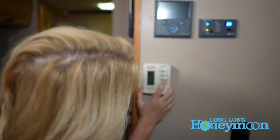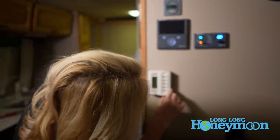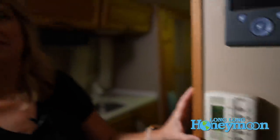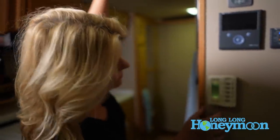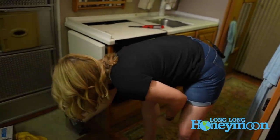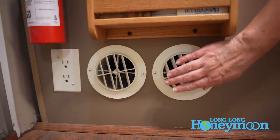Just kick everything on. This is our air conditioner — we're going to wait for it to kick in. Flowing nice and cold. We'll turn that off, then kick it back on and set it to heat pump, crank up the temperature, and see if it gets warm. Several minutes later — and then last but not least you have to check your furnace. Kick that over into furnace mode, wait to hear it — whoosh — the telltale squeaking means it's working.